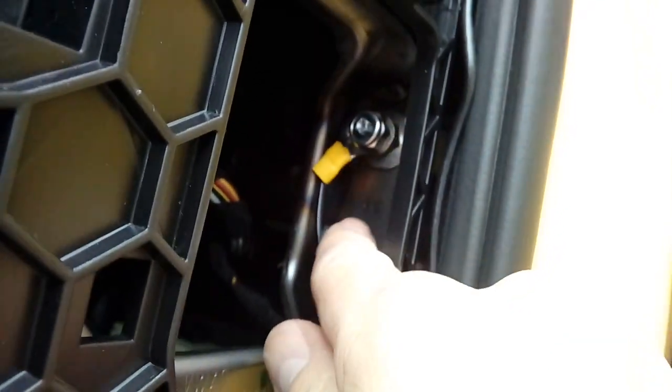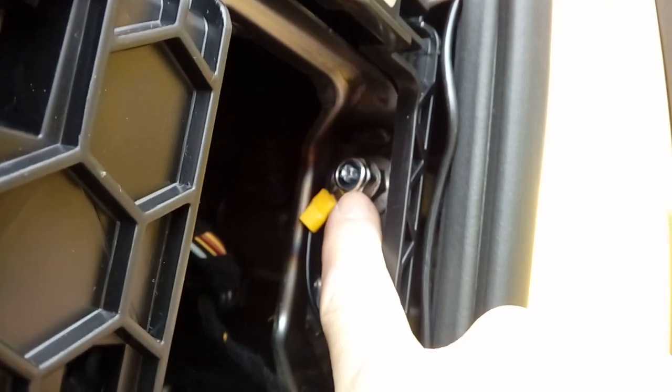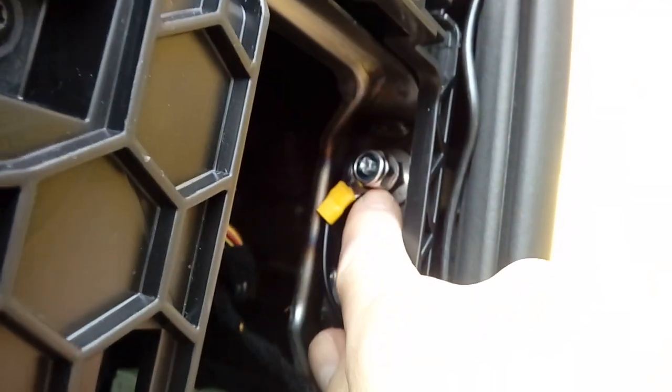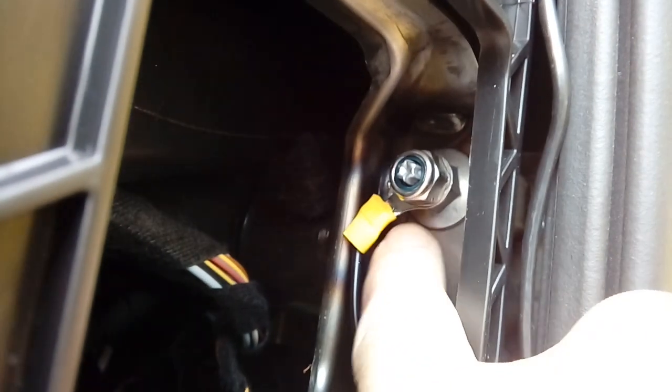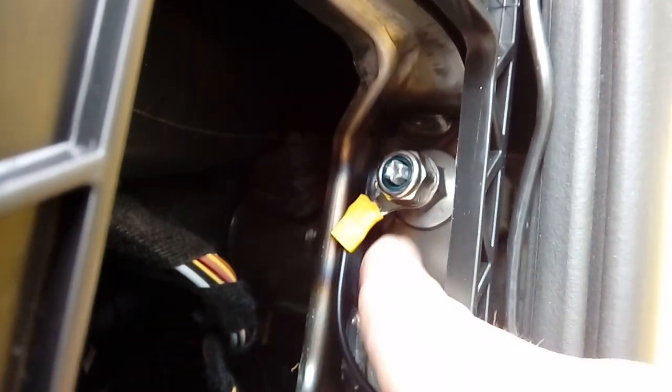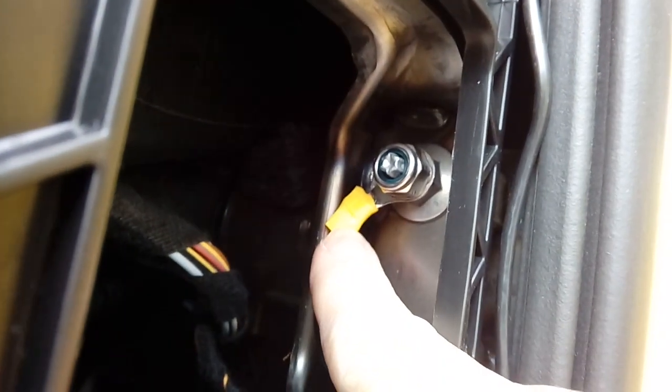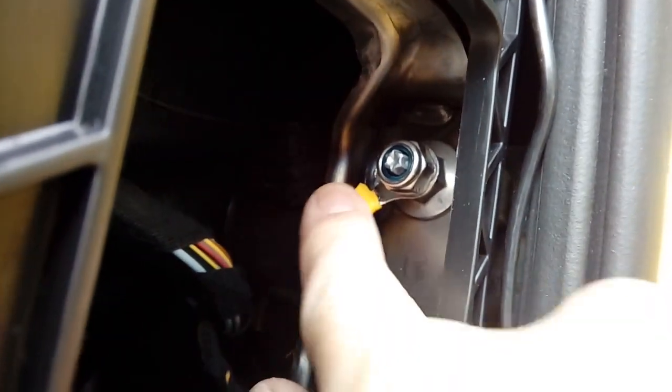You can do and put it behind it, it's not a big deal. But I had some spare bolts and nuts lying around. So all I've done is use the extended stud and put a nut over the top of it. And yes, the keen-eyed among you will notice I've put a full ring terminal on the end of the earth cable instead of the horseshoe one that comes with it. Just years of doing it and a little bit more secure.